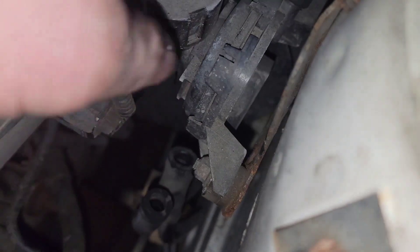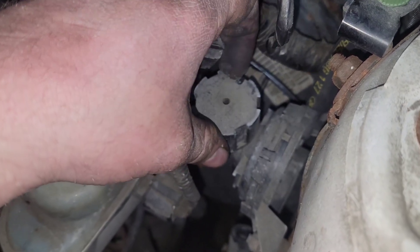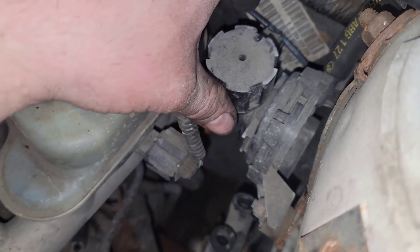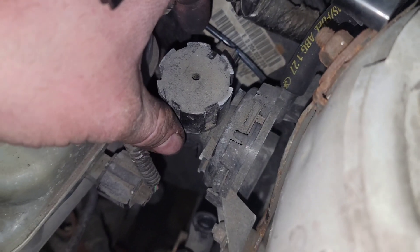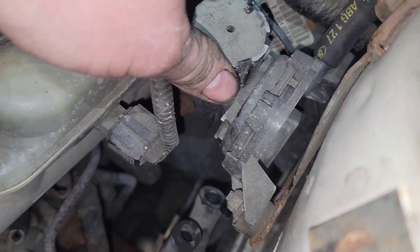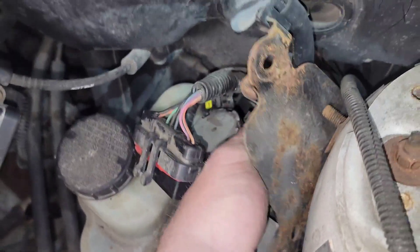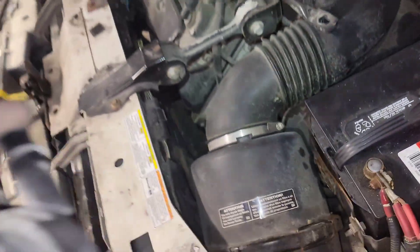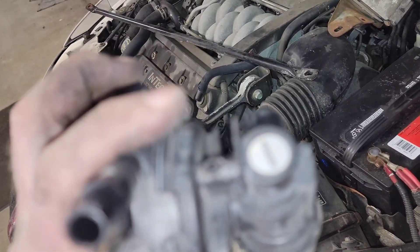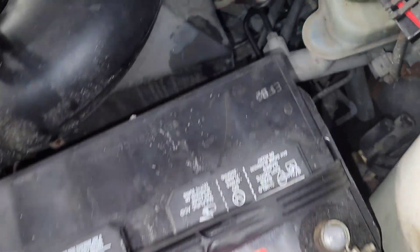At the top of the strut tower brace, I'm explaining the purge valve assembly — vacuum assisted. There are two 13mm bolts right at the top of this housing that come off, and you slide the whole entire assembly out. When you buy the new one, you get the whole bracket and everything with it. The strut tower brace was 13mm, the cruise control module was 13mm, and here's the broken little nipple that came off and goes into that tube.